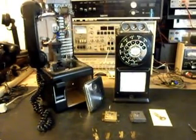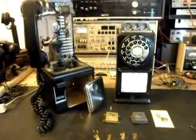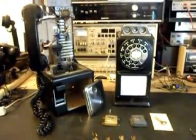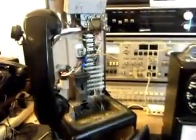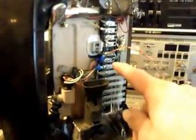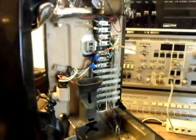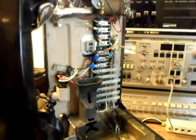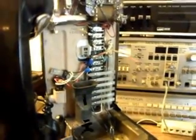This telephone had a line cord that was just hanging out of the back. When a lot of these telephones got converted, people would just throw a line cord out the back through the hole in the center. That's not the way we do things here. I install modular ports, so we've got a modular port installed and Ron can simply plug any kind of line cord he wants into it — any length, any color — which gives him a lot of options without a tacky cord hanging out the back.